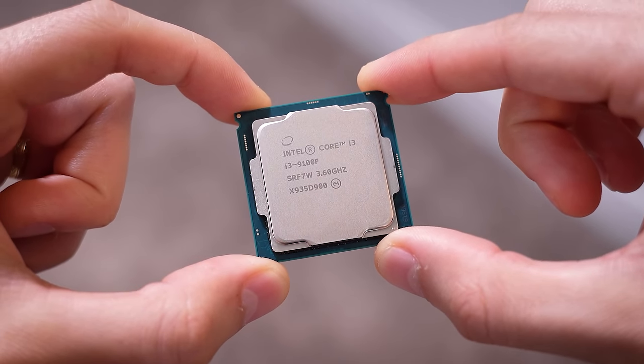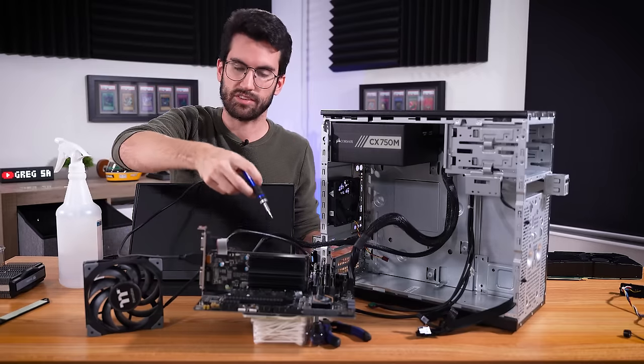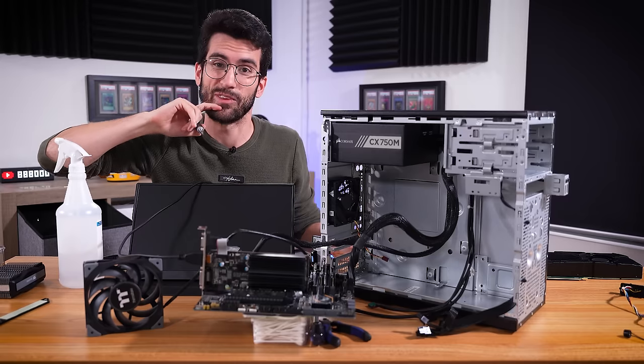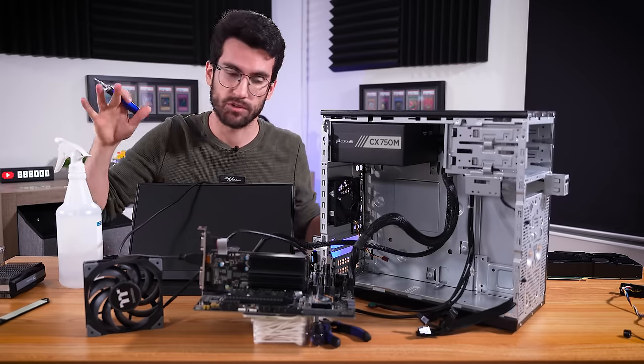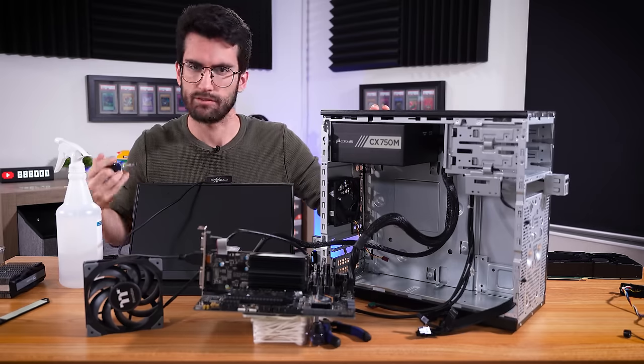Although we could have a situation where both the CPU and the motherboard are dead, and that's the worst thing to physically troubleshoot. The hardware is usually pretty straightforward, but when you have multiple dead components, you're getting mixed signals from different combinations of hardware being connected — you're just chasing yourself in circles sometimes. So I hope that at least his CPU is fine. The setup looks a bit sketchy — I had to connect a discrete graphics card because this is an F-SKU with no IGP, and I had to lift it off the board using a Q-tip box.